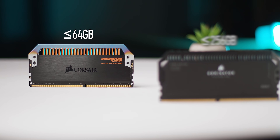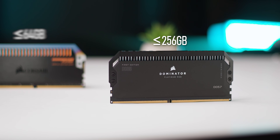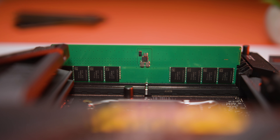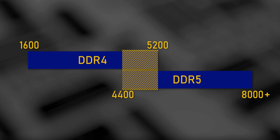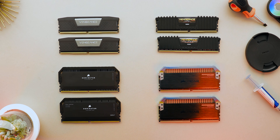While DDR4 modules can have up to 32, and in some edge cases 64 gigabytes of memory, with DDR5 we're already seeing 64, 128, and even 256 gigabyte DIMMs. The only thing is that your CPU has to support it — for example, Alder Lake CPUs can support a maximum of 128 gigabytes total for the entire system. If we look at performance, though, the current high-end DDR4 modules can technically beat DDR5. With DDR5 we're going to see modules go from 4,400 megatransfers and go way past that. Compared to DDR4's range of 1,600 to about 5,200 megatransfers, there is some overlap. But don't think that DDR5's frequencies alone will lead to it being better than DDR4, since the fastest kits from the previous generation will offer just as much raw throughput and at tighter timings.